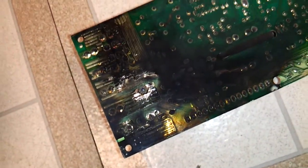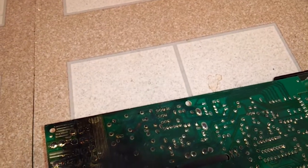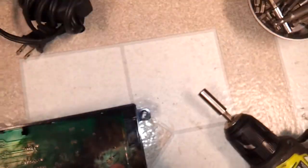Here's what happens to these things. See that? This control is junk. In most cases this can be fixed — I can put a new relay in and remake those connections with some solder braid, and that's about it. But the problem is when this happens, the copper snot will blast right here. That's part of the control circuit, where that big processor is. So just about every time that copper snot blows off, it takes the processor with it. So this board is junk. It can't be repaired.